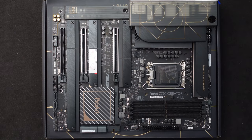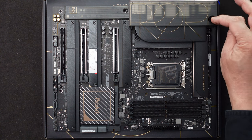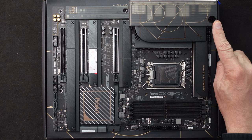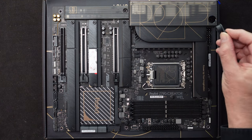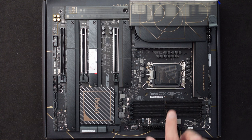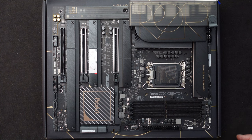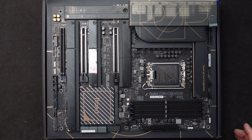Let's take a look at the main section of the motherboard now. The right-hand side here is what would normally be at the top of most cases. There's a hole here where the ninth screw goes to connect the motherboard into the case — they give you a little rubber plug that you can put in there to prevent dust accumulation inside that hole. The CPU socket is LGA 1700, supporting 12th, 13th, and 14th gen CPUs. There are 16+1 dual power stages on this motherboard — not the highest available for high-end gaming boards, but pretty good and would work for 95% to 98% of applications, other than extreme gaming. There are three PCIe slots, both sized as x16 in terms of physical slots.